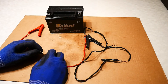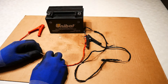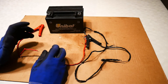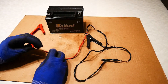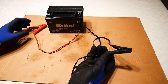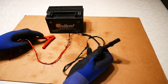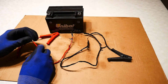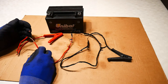That's why it's important to always replace blown fuses with the properly rated fuse, and never short the contacts with a piece of metal — it's extremely dangerous. Your whole motorcycle could go up in fire in a couple of seconds before you could even react. It doesn't just break at one point — it disintegrates the whole wiring harness equally, all the way along. And once you have bare wire, your electrical circuits won't work because the wires will be touching the frame or other metal, creating further shorts in the electrical circuit of your motorcycle.